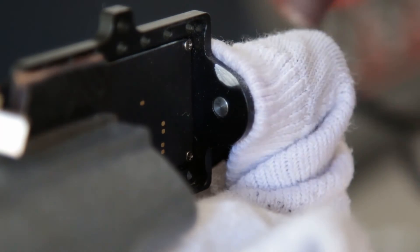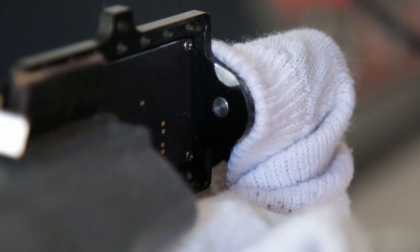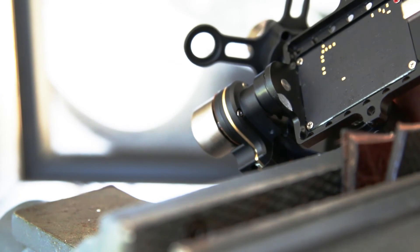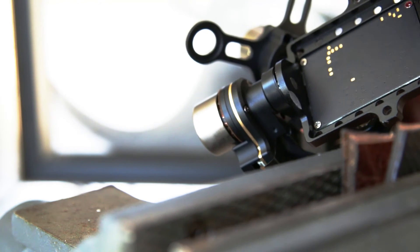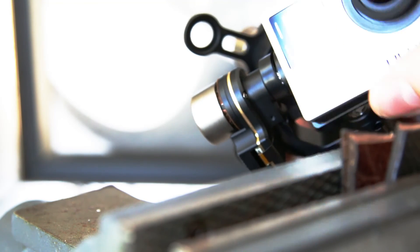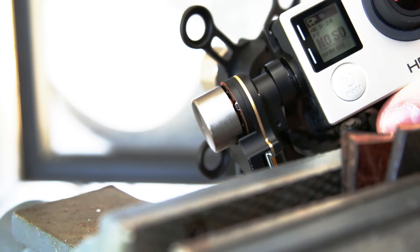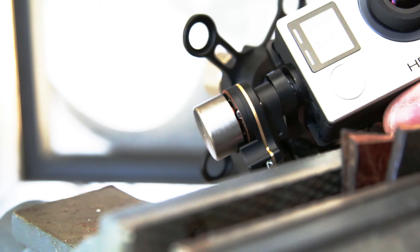It's starting to look pretty good — pretty even. Not a whole lot of material comes out, but it should be just enough. The trick is to not remove too much; always test it as you go. Looks like we got just enough out — you can see where the material was removed, it makes almost a half-moon bowl shape. If I slip the GoPro in now, perfect — it doesn't press the button at all. In better light you can see how precisely you can machine it down to look almost factory.